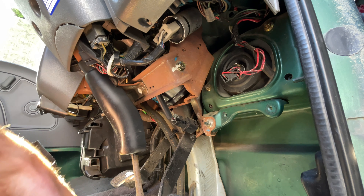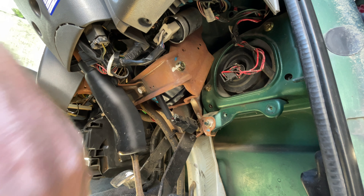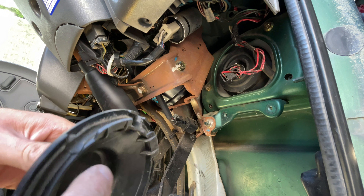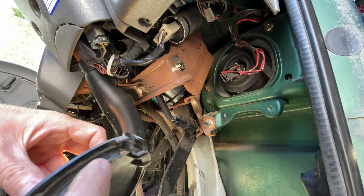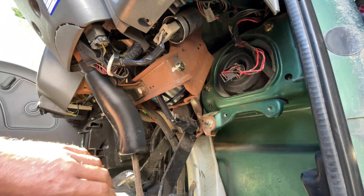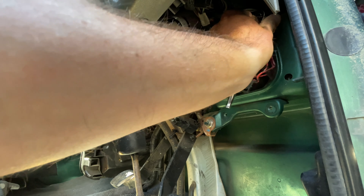To remove the headlight, I took this off just to give me a little more room — you're going to have to anyway — to unplug it, or just pop the light out and then unplug it. You're going to need a 10mm to take the plastic cover off. The two bolts are here, and you'll notice at the top of the covers they usually have this foam gasket that gets stuck, so just carefully pry it off. Up here there are these little parts that slide up into the frame or body above the light, which holds the top so it doesn't flop off when you mount the bottom. You're going to want to undo that, and then you have your two 10mms holding the light.